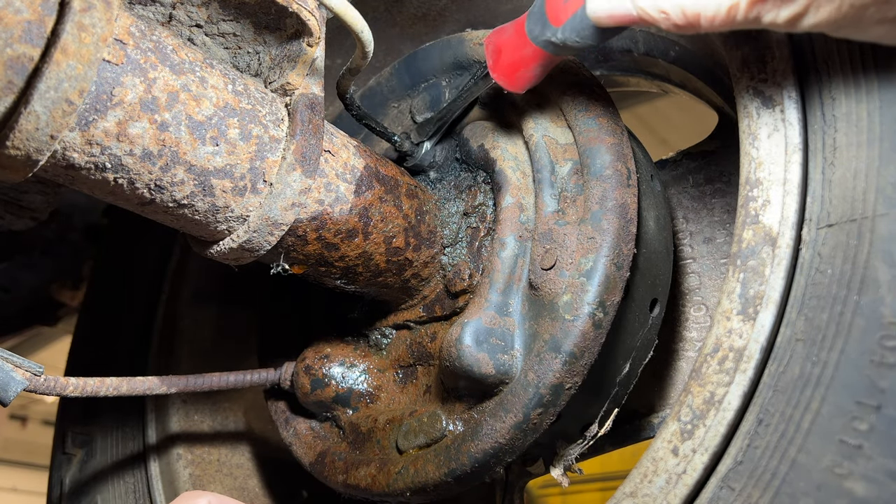Now let's see if the drum will go on. The truck's in park right now, so I can't spin it fully, but that feels good. Now I can top off the brake fluid, bleed the brakes, and it should be back in drivable condition. That's all I have time for tonight with the Bronco 2. Really, I've only put an afternoon's worth of work into the Bronco so far — there's still a lot to go. If you want to see more Bronco 2 videos, comment below and click subscribe.